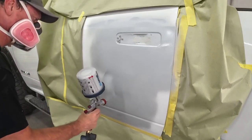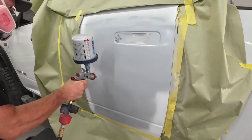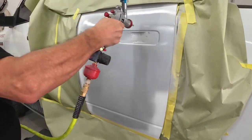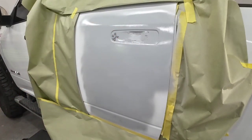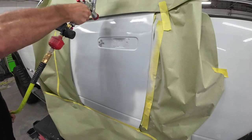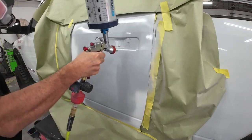You'll notice I didn't mask off the entire truck when I'm priming, but it's not really necessary because this gun does not produce a lot of overspray. When you're applying your primer, you want to apply it just like paint. We're going to put two coats of primer on this — this is 2K Urethane Primer. We'll apply the first coat, let it flash off for 10 to 15 minutes, and then apply our second coat. You want to apply a nice flat coat, overlapping about 80%, and keep a consistent distance and speed from the panel.